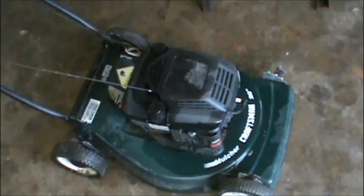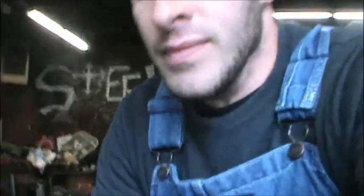The first things you need to know on an engine like this is how they work. The gasoline engine has a tank with gasoline in it, and the gasoline runs down to your carburetor. The carburetor is gonna cause you probably the most problems on this lawn mower or your weed eater. The carburetors get dirty — they have little needles inside there. The gas goes from the tank down to the carburetor through a hose, and there's a little needle called a float bowl needle. That needle has a rubber tip where it opens and closes, and over time that rubber tip will get soft and get eaten up, and you'll end up with a no-start condition — not getting any fuel.